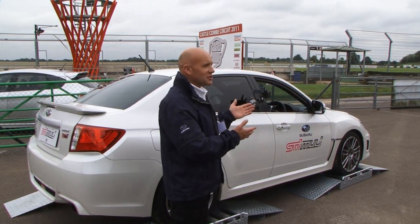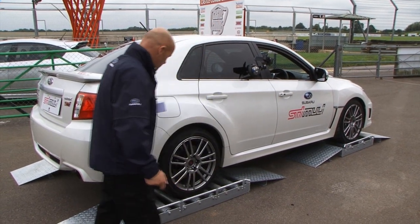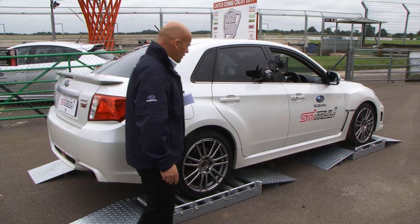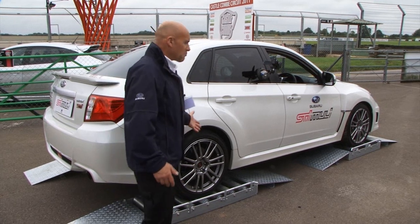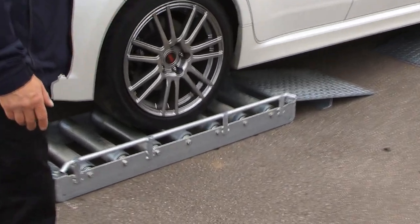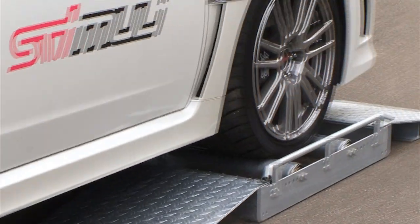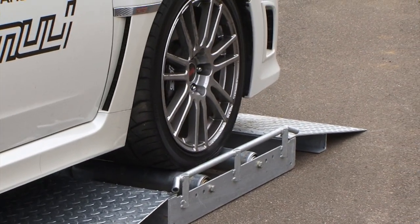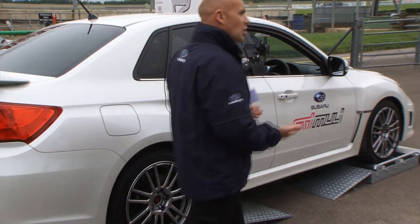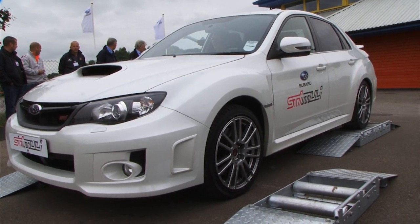So what I've actually done is built a set of rollers to emulate a slippery surface. These rollers are all on precision bearings, there's no locking mechanism, they're all free to rotate — so in effect that is like black ice and more. I've got the two rear wheels on these seven roller beds which gives us a long flat surface as near as we can. The front wheel on this side is in a wider set of rollers to create resistance so we can't just push the car off easily — it's a bit like uphill. The other front wheel is on the tarmac and that wheel is the only one with any grip.